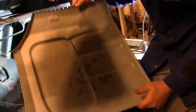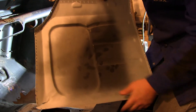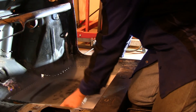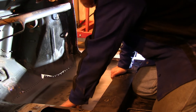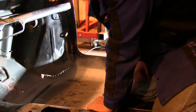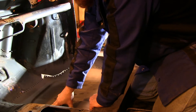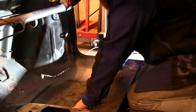This is the moment. I've got my floor pan here. I've got it notched, I've used some weld-through primer on it, and it's ready to fit directly into the little slot here. I'm just going to get it in there — it fits nice. I've got kind of a weird cut up here because I've got a big old crack in the steel, which is a bummer. But yeah, it's in there pretty good.